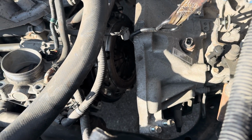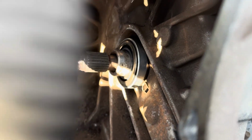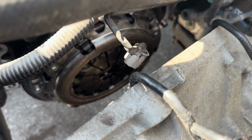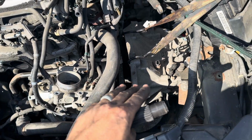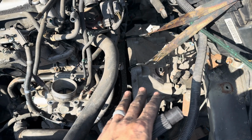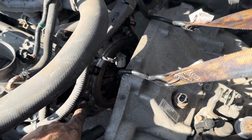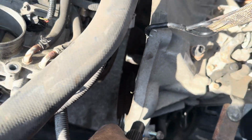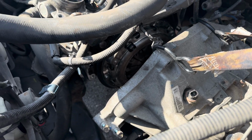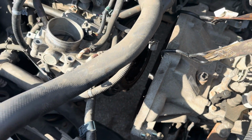Okay, so let's go ahead and we got this done. Pressure plate, flywheel, clutch. Now we can put the transmission back on. I'm gonna get my transmission jack back under there just so it don't fall, get my strap off, everything. There's 2 dowels on the side of the bell housing, one in the back right there. Those fit into the transmission housing. Slide it in, make sure it locks in good, be careful. And then we can start some bell housing bolts.